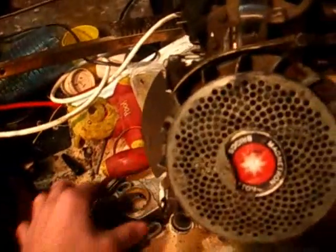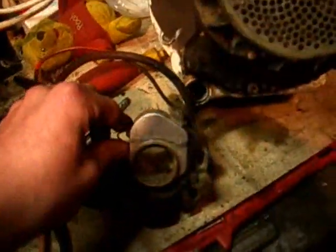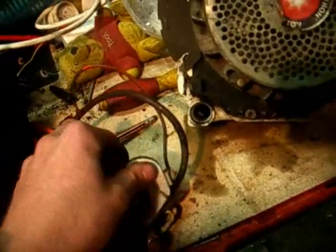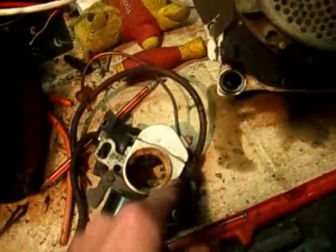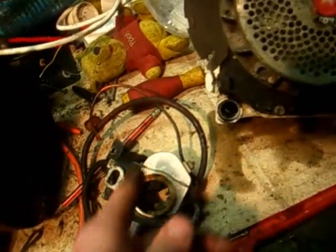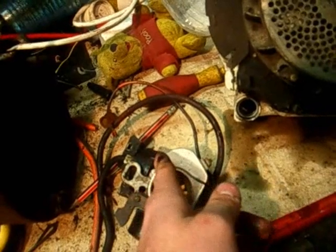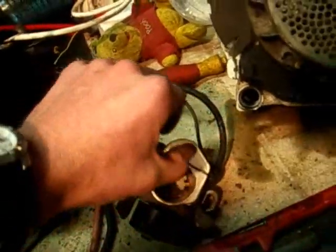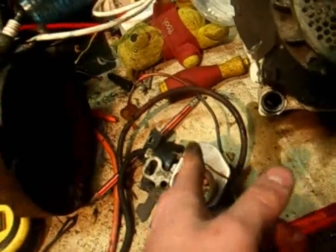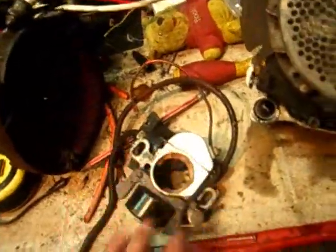To clean and adjust your points once you get to them, you'll need a feeler gauge to re-gap them. It's a pretty easy process — undo a screw, and when your points are in the open position, place the corresponding feeler gauge size between them. Swivel the points assembly until the points put very light pressure on the feeler gauge — not too much or your timing will be off — then do it all back up.